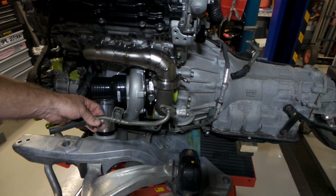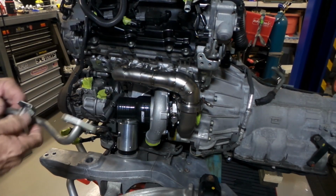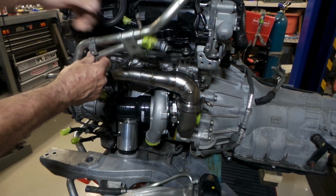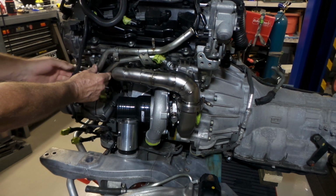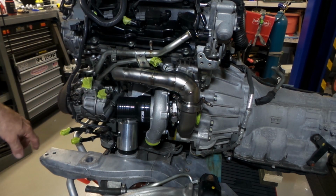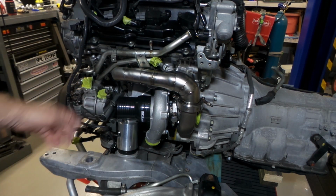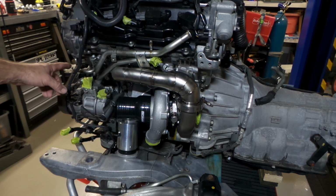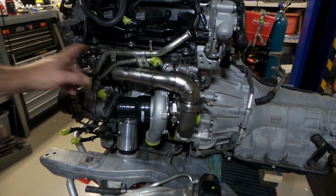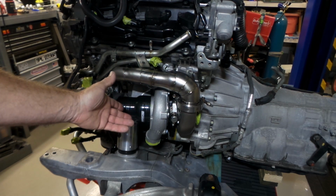So this is redundant, and what I did, I looped this back. The other end of that actually connects up into this fitting, which is sitting over here. So that's one end of the loop, and the other end goes on here, and this pipe sticking out of this end snakes around under the engine, and these things both snaked across to the other side of the motor, and that formed the coolant flow through for the oil warmer cooler. So all I did was just run a hose from one end to the other. I just put a loop on it once I deleted the unit, so water was just continuing to flow through. Main reason being I didn't have access in behind the exhaust manifold to do anything with it.